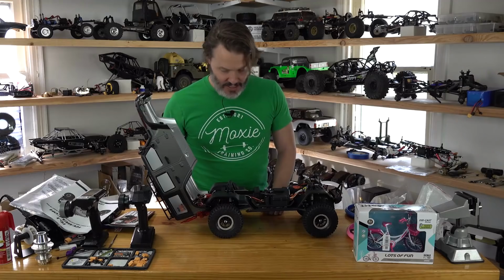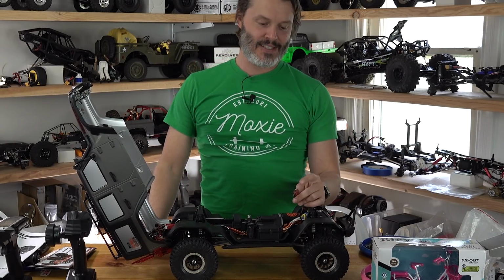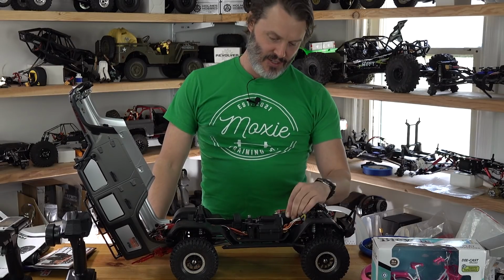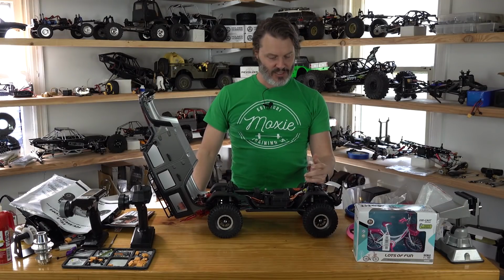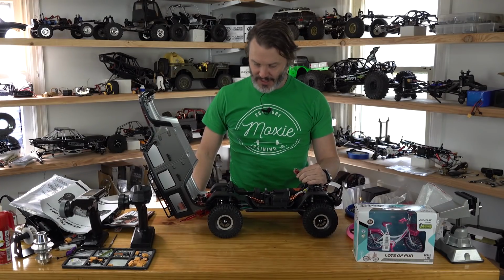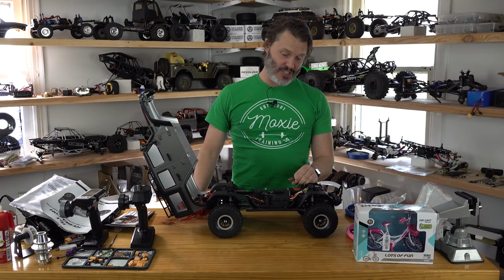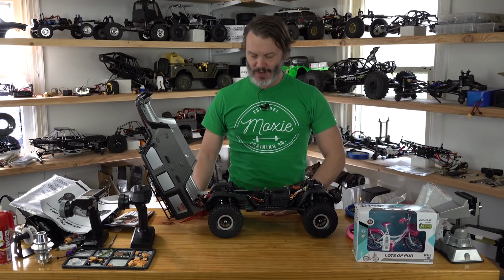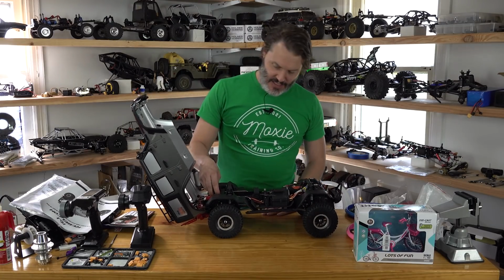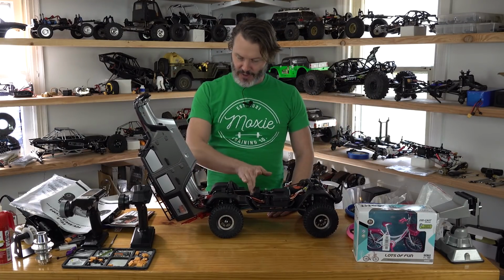Yes, indeed. All right, so the next thing we need to deal with is this Dean's plug. If you're a regular viewer of the channel, you know that I no longer run Dean's plugs or T-plugs, whatever you want to call them, compatible T-plugs. So I either need to switch this out to an XT60 or I need to find my adapter before I can ride this thing. Should note that this does have a full-size pack in here.